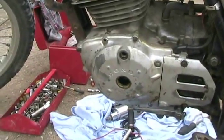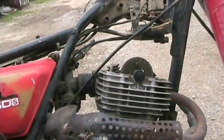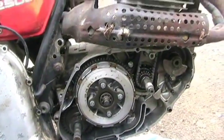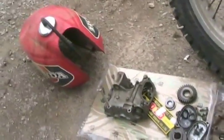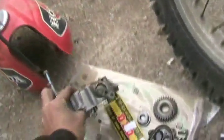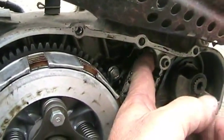Next up, just put those two caps back on screwdriver-tight. It's up to you whether you want to reassemble the top or bottom of the motor first — it makes no difference. If your valves are already set right, they don't need to be reset. This is a single cylinder, four valves per cylinder. The faces on the rocker arms are in good shape, and the pin is reinstalled.